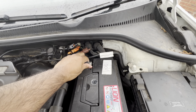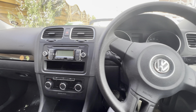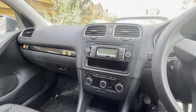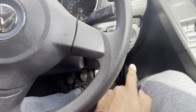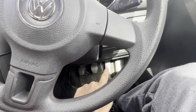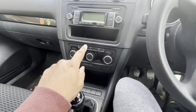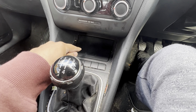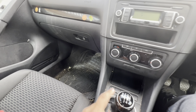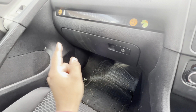Make sure you disconnect your battery and leave it disconnected for 10 minutes. To remove the dash you've got roughly 40 to 41 screws all over — screws underneath, as well as 10 bolts for the airbag, screws behind the center area like the radio, the heater box, the vents, and behind the ashtray.